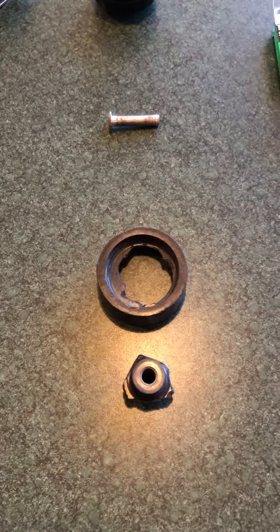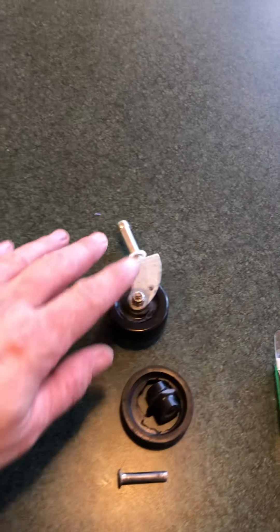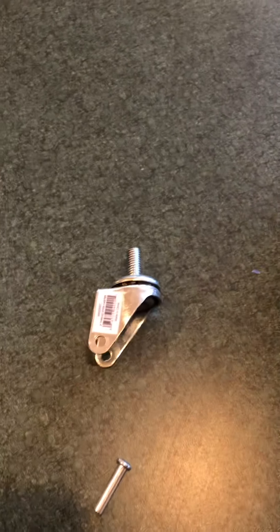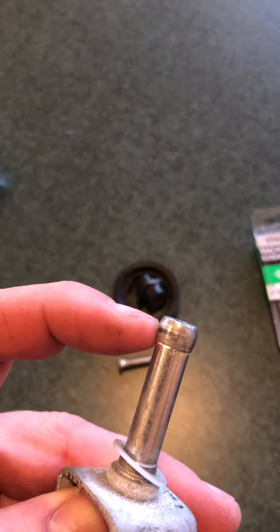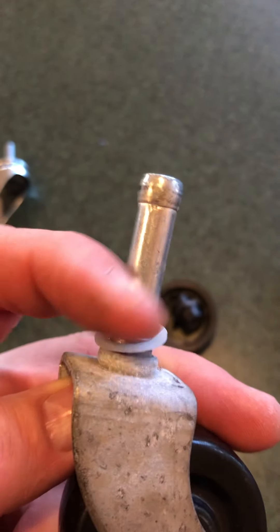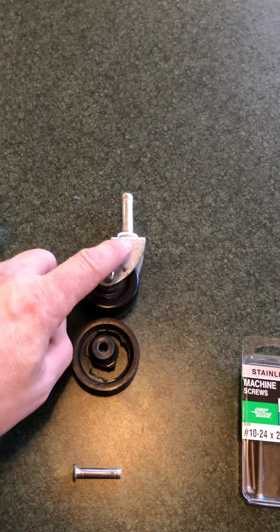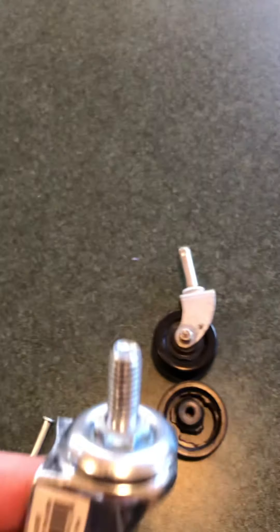Here's what it looks like — here's the broken one, there's the center part that's busted out of it. So here's what I did: I went to a local hardware store and I bought this caster — I should have showed this from the beginning. This had a wheel inside of it. This is the actual shop vac one, and if you can see, it's got this knob on the part, it's bulged out there, and that snaps in. There's also a little white nylon spacer washer. This busted part was on this housing — the wheel was in here.